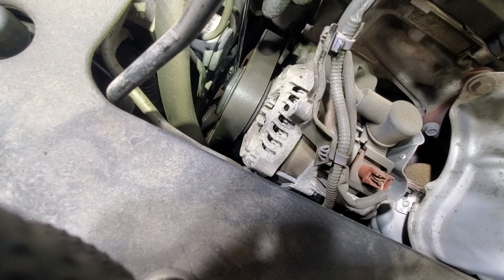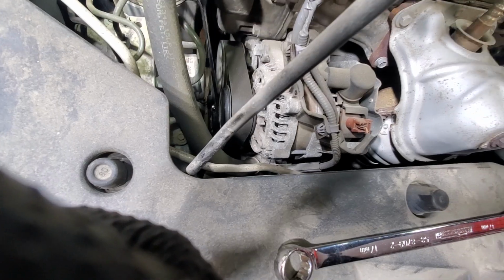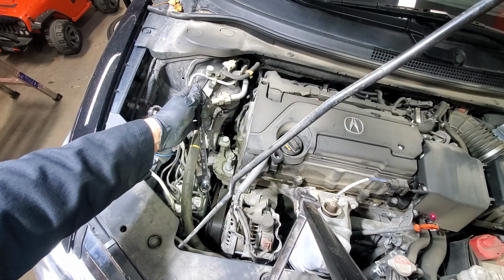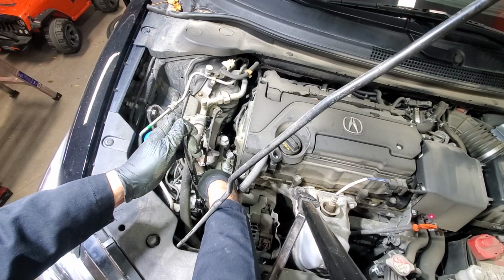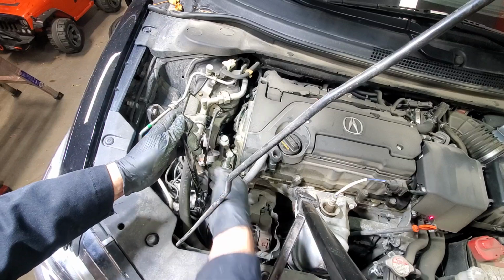So you can actually go ahead and put it on, just like that. Let's try to shine some light. So it is on, and we will need to pull it towards ourselves. I have doubled up wrenches, and just gently pull it towards yourself. Now you can see that this belt is loose, so we will take it off.